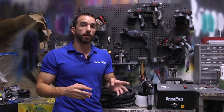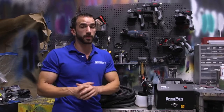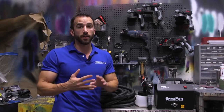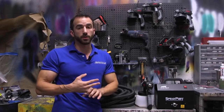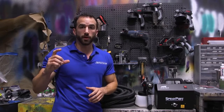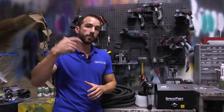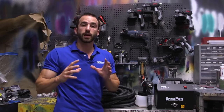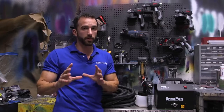75 grams of Mariana Blue, that's a new KP pigment that we're launching on DipYourCar.com. Very strong coverage, very, very deep blue. It's beautiful. Then we're going to take that really, really well done real red pearl and we're going to mix 25% real red to the 75% Mariana Blue. That's going to come up with some type of purple or violet.